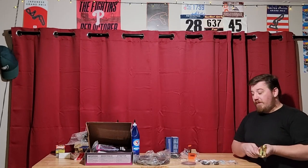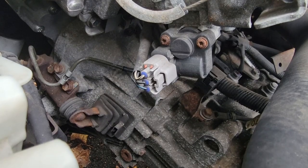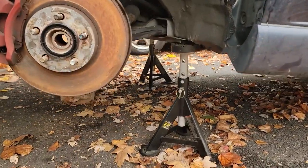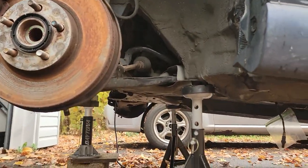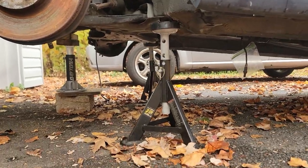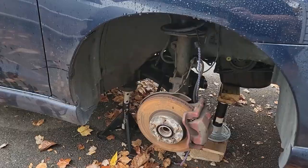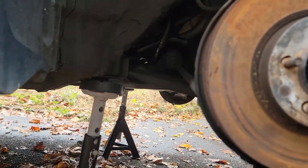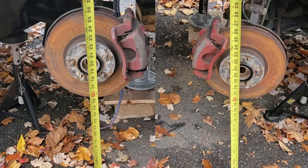First thing I wanted to do was check the slave cylinder — check the travel and pressure. I gave it about 15 to 20 pumps to make sure it didn't get stronger as it went, which would indicate it needs bleeding or the slave cylinder is broken. That wasn't the case. To jack the vehicle up, I use the outermost corners of the K-member by the wheel well and try to get it up around 24-26 inches for enough clearance to get the driver's axle out.